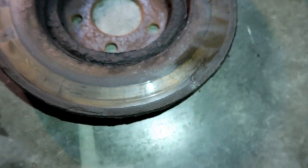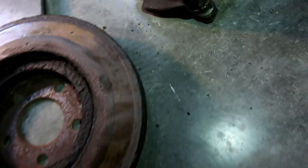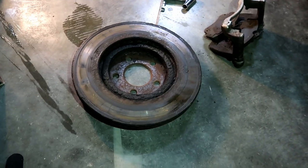The other side I think is going to be even worse. Over here you can see it was just bad — partly the pads, partly the rotor. The rear pad is worn quite a bit more than the front but still has life left in both. We're definitely going to be cleaning out our guide pins and making sure they're good to go and lubing them up. But these rotors have just seen better days — they're also really warped. It's time.